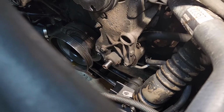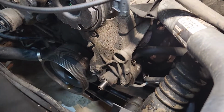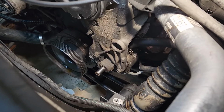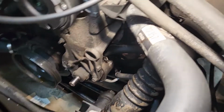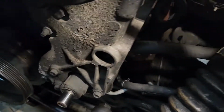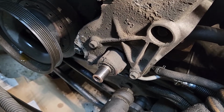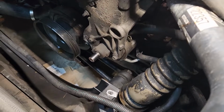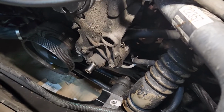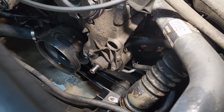This power steering pump's a little different from a Jeep power steering pump. You can get the pulley off after you remove the pump on the Jeeps. But this one, you've got three bolts beneath that pulley. You can't get to them until you get the pulley off. So, get the puller, pull the pulley off. Now we can take those bolts off and maybe one or two at the back, get those clamps undone, get this power steering pump off.